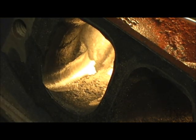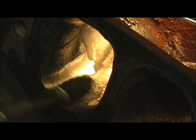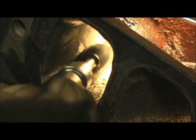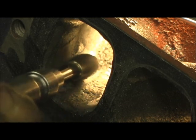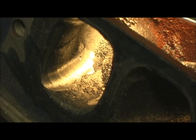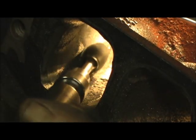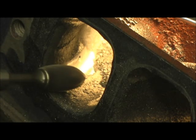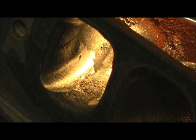To give one of these ovals the right shape, it's a lot of work on the roof of this port — just a ton of meat, especially where that big bulge is where the rocker stud goes. Now you can start to see where it's busting through right there near the outer part of that bulge. That, my friends, is seriously laying waste to this turkey.